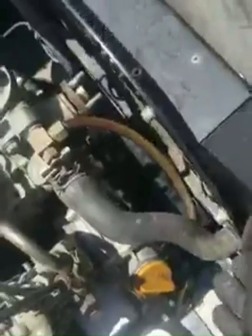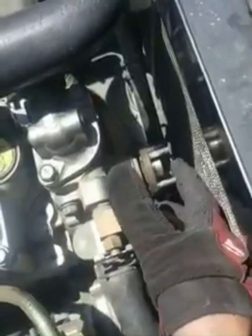So I got my water pump belt off. You can see there's a pulley right there. Now, to get the water pump belt off, you need to loosen up this housing. Take the screws out all around. You may even want to remove the front fan a little bit to give you more flexibility. I would recommend using a 10 millimeter socket — a six point socket — because there's a real chance that you could strip those heads and those bolts.